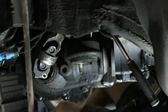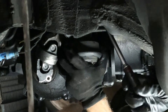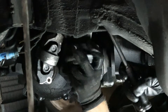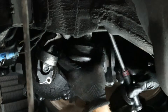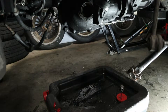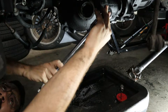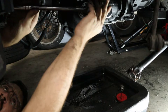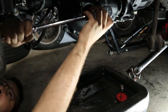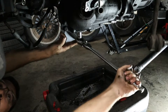Here I'm removing the motor mount — we also have two brand new motor mounts to install, so that's something you want to grab if you're doing this job. Before we drop the differential we have to drain the fluid out of it. I'm using a 14 millimeter Allen on a socket to get both plugs loose, and that's going to let all the fluid out of it.